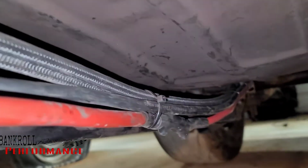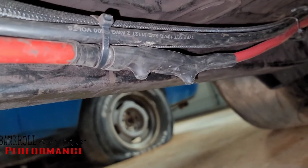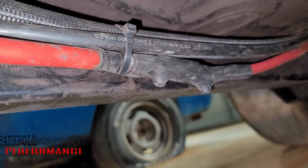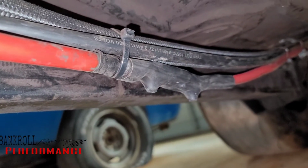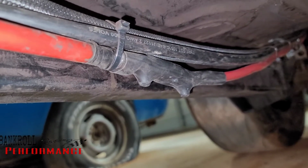This is going to be the issue at hand today: to fix this fusible link and figure out what size it is, but also we're going to get rid of that. We're going to probably just order a whole other relocation kit, so there aren't any splices or any of that mess, and just make sure it's safer.